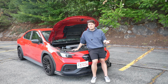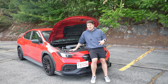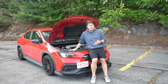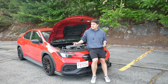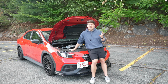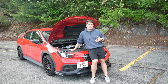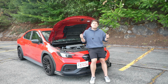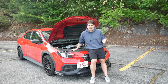If you're putting an intake on anyways, a dealer is going to treat that intake as if the car is tuned when they're talking about warranty cases. You're not safe running the intake. And I will actually go as far as saying that I've seen on a lot of these cars, and I've been talking to a lot of people, and the engineering supports it, that if you run an intake without a tune and it's safe to run, the fringe case where you might get one spurt in air, or it's out of bounds of the safe-without-a-tune section, might peak your boost higher than the outer bounds for these stock cars, which is already going to flag for a dealer anyways.